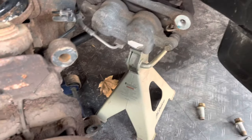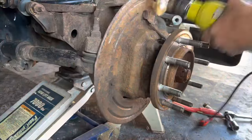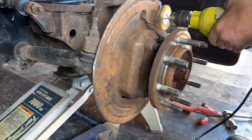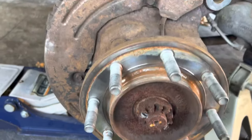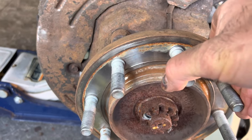That's probably the reason why some people don't have their rotors turned. You should never put new brakes on old rotors. These brakes here are still pretty damn good — it's just they put new brakes on old rotors. You can see where it was actually sticking.